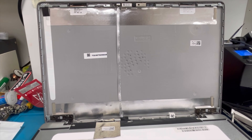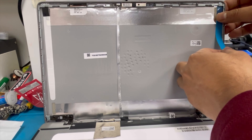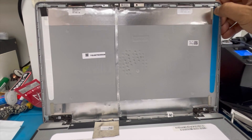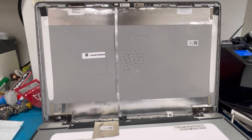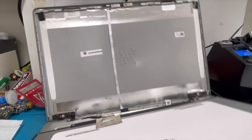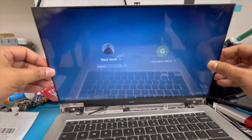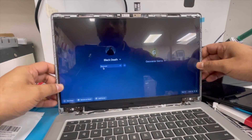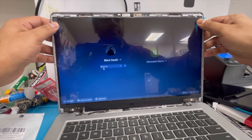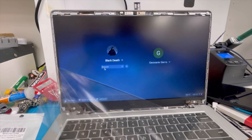The right side is the same thing. We're going to install from the top side and press it down. It's nicely installed — remove the plastic. Now we're going to install this screen. First we're going to do the bottom side — hold it, then just push back. You can see it holds the screen with the glue on it. Remove the top plastic. It's done here.